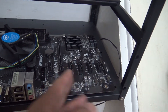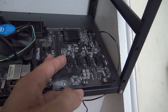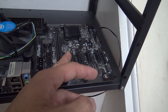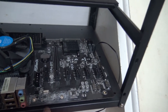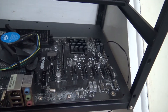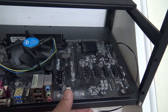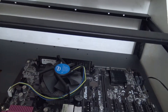If you have like three PCI lanes there are other attachments you can add to get more lanes, but six and up is ideal. You can get boards with eight lanes or even 12 — some boards have 18 lanes. The speed of the CPU and RAM doesn't matter as long as everything works together; what matters is the graphic card.